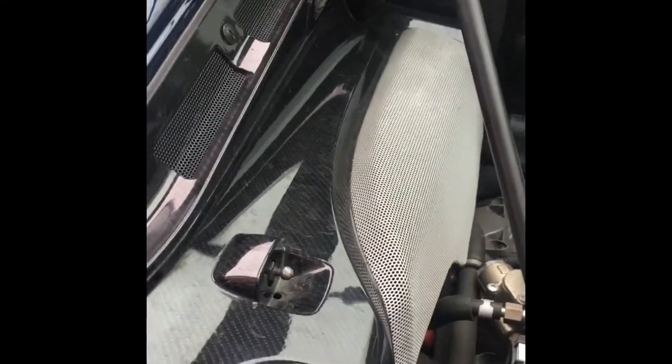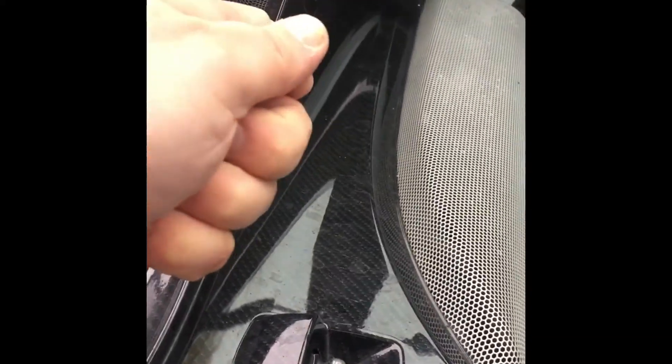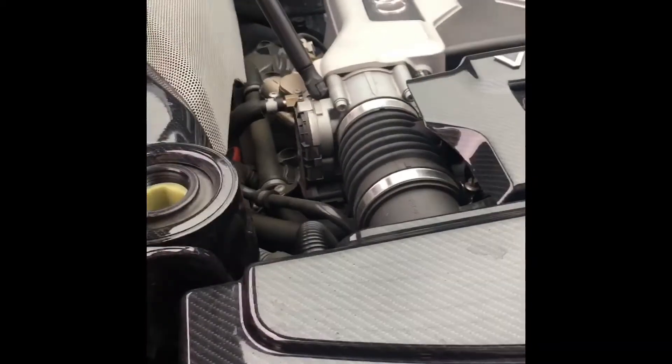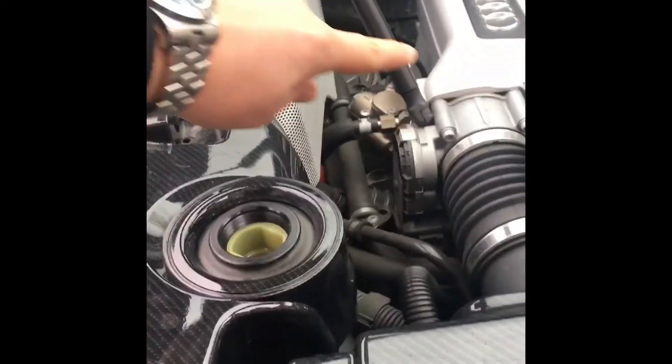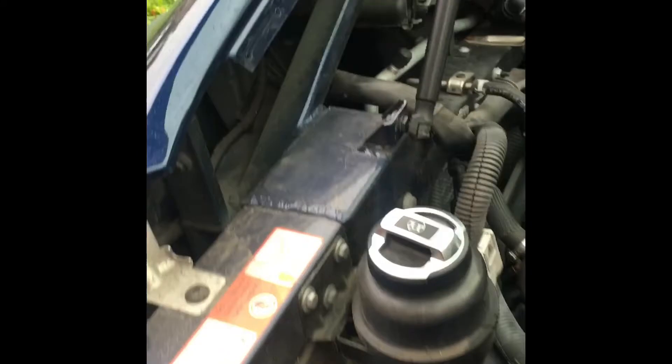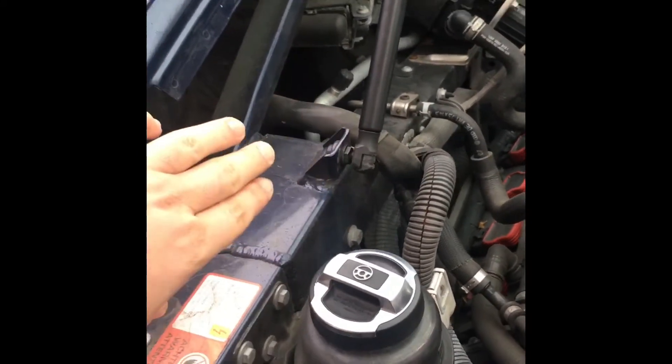These are all pops — that one did come out. We've taken the pin and ring off. I'm just propping that against there to help. The steering fluid lid needs to come off as well, and now this is all free to go. I won't video the removal with both hands to avoid damage. There is a light in there — as you start to peel this off, just reach inside, disconnect that light, give it a wiggle, and it should slide straight out.